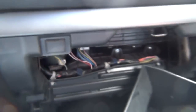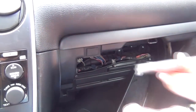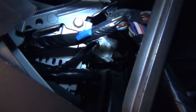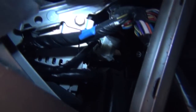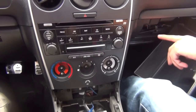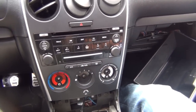There's one main screw holding the radio and it's a little hard to see. There's a 10mm bolt right there — that 10mm bolt is what's holding pretty much the whole radio, except for those four screws we showed you. For that you'll need an extension. We're now going to go ahead and remove that one bolt and the four screws — two on top and two on the bottom.